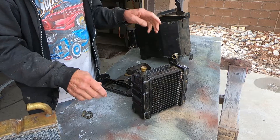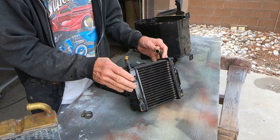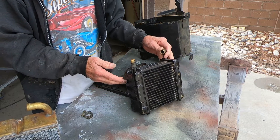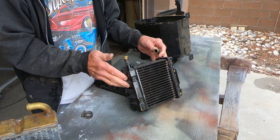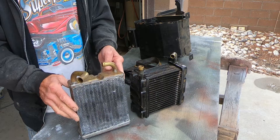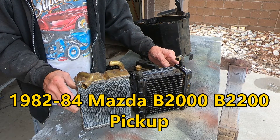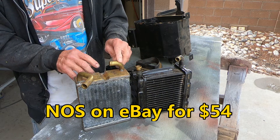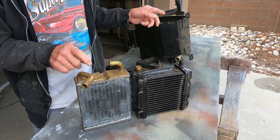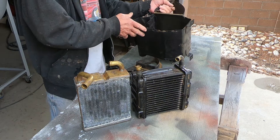Here's where I'm at on this thing: unfortunately, they quit making these heater cores for the 240Zs about 20 years ago and apparently all of the excess stock that was on hand has been used up. I can't find one anywhere. I can find some used ones, but they say they're good and I'm afraid they're going to be in the same shape this one is - if they're used, they're getting rotten. So what I was able to do is go online and search a jillion different heater cores and I found this one, which is out of an early 80s Mazda pickup. You can see it's more or less kind of the same size - a little bit taller - with an inlet over here and an outlet over here. So I think I can adapt it to fit.